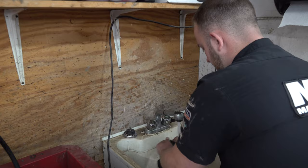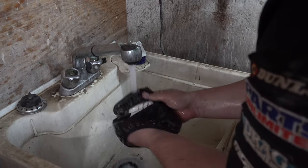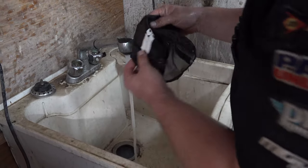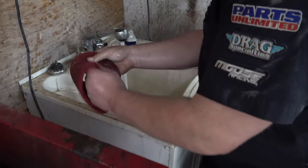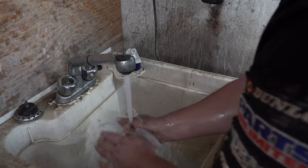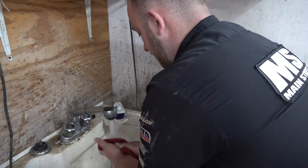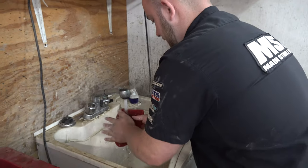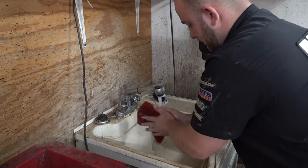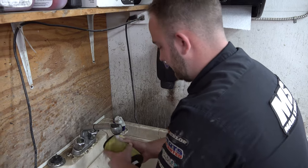Now that we let them soak, we're going to put them in the water. All you do is rub it in with your hands and rinse it all off good. This is the outer wear that is available here at Main Street Cycle for the upgraded uni air filter setup. You want this to really air dry. Be sure not to do this with your stock filter because if you get water on it, it'll come apart and suck pieces into your engine.